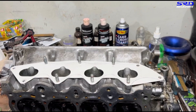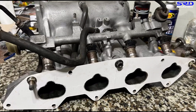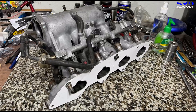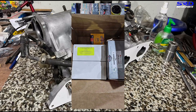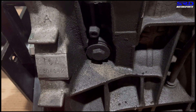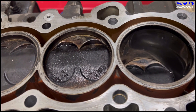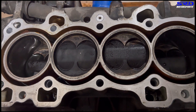Here we cut the template of the intake gasket so we can use it as a pattern to port match the intake manifold perfectly. My friend Josh, who owns Motor Corp Solutions, offered us a hookup price on the PCT pistons for this project, and the owner jumped the gun - they're already packed and as you watch this video, they're probably arriving in a few days. From the previous episode, we couldn't remove the crank or disassemble the block because we couldn't find a size 17 12-point socket. We ordered a new set and it arrived a few days later, so we got to disassemble it.